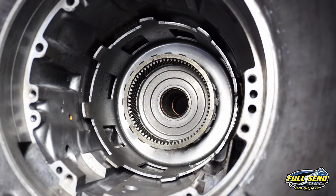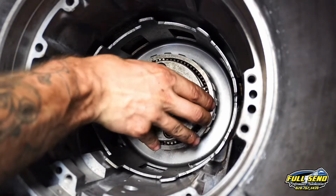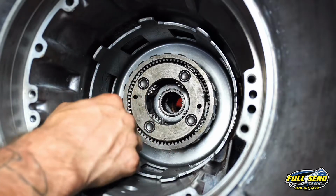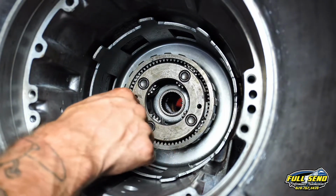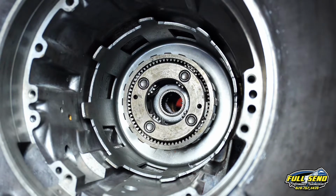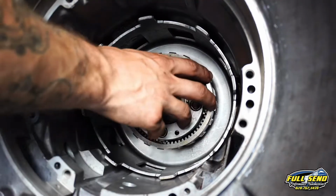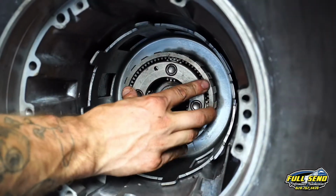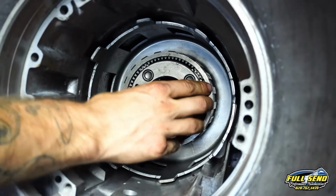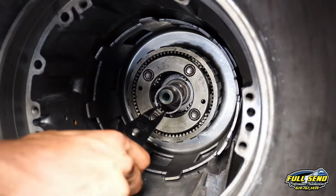After your main ring gear, you're going to take your planetary and get your bearing on top of it just like that and drop it in nose first. I know this is an old style planetary. It was just in good shape. The 2 dots indicate that this is a pre-auxiliary 700 R4 upper planetary. You want to feed your output shaft up and through your transmission here, until it bottoms out like that. Oh, come on. Alright, now your snap ring goes in here just like so.